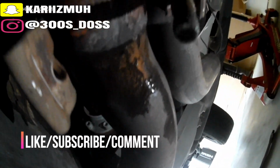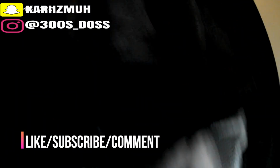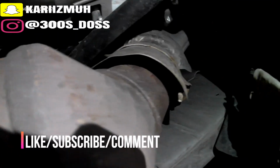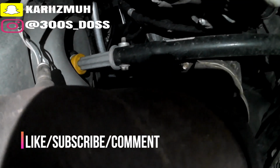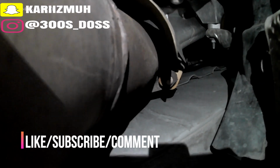I don't know what that fluid is, but you just get a hammer, beat it, and it should come off. That leads to the X pipe right there. And now there's the O2 sensor. I'm gonna disconnect that sensor right there. Goes into the cat. Only thing is, on the driver's side I guess it has a heat shield for the starter right there. Oh, it just latches on right there, but I definitely need a universal swivel joint. And yeah, get those two bolts on each cat and they should be able to come off and see what I can do.